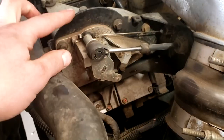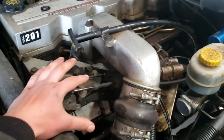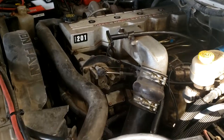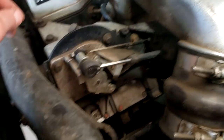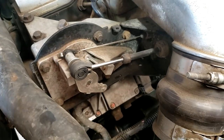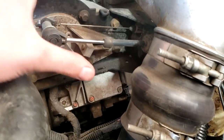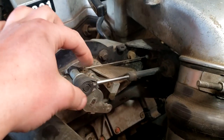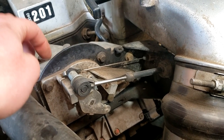The next step is to get to our actual APPS so we can start adjusting it. To do that we have to take the black cover off located on the front of the motor on the driver's side. Mine didn't have a cover on it — I think it's just a bolt up here and then one in front. Pop that off and then it'll be six 10-millimeter bolts that we're going to have to get off, and then this whole thing should come right out. We're not going to mess with any of the throttle linkages, so don't worry about that.